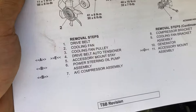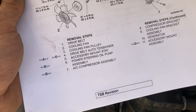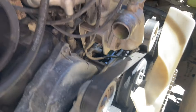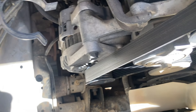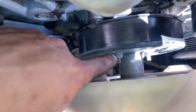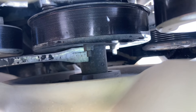At this point we've taken off the shroud and we're down to the accessory belt, and this is where the factory service manual really starts to come in helpful. We're going to take off the drive belt, cooling fan, cooling fan pulley, and auto tensioner — just take all that off the front. One thing to keep in mind: this is the time to disconnect your battery since you're going to be pulling the alternator lead — you don't want that hot wire. The fan pulley bolts can be hard; they're 10 millimeter, so my trick is to wedge a pry bar in there to hold it.